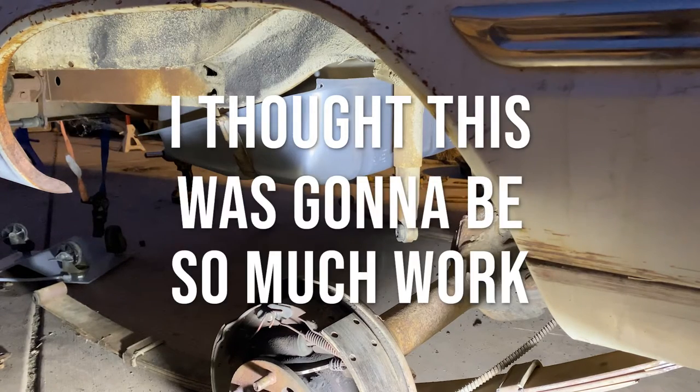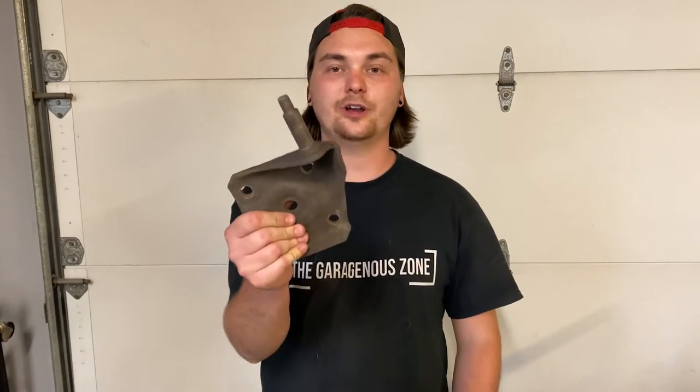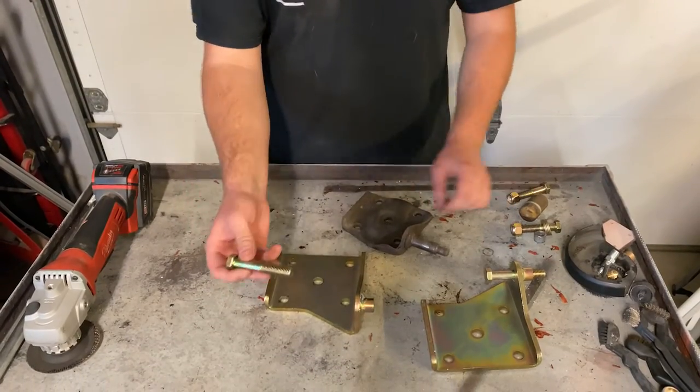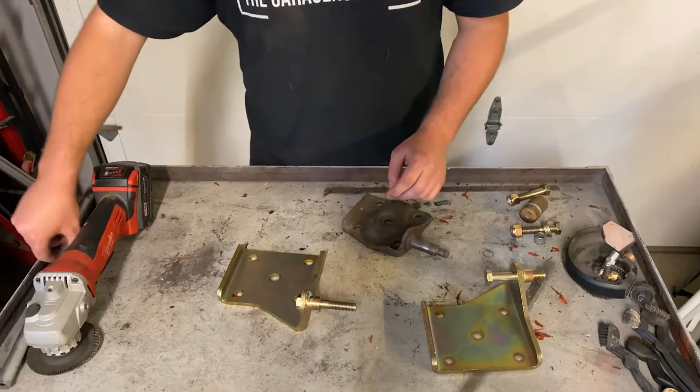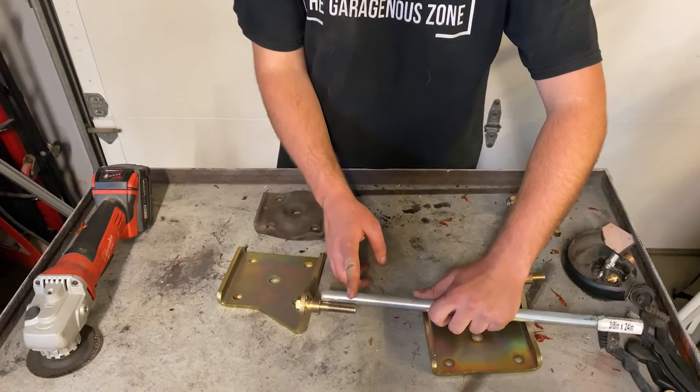That's insane — I thought this was going to be so much work. So we have a dilemma, but luckily it's one I know how to fix. This is the old spring plate from the Valiant, and when we swap to the 8 3/4 inch from the Roadrunner, this is no longer compatible. We had to order new ones for the 8 3/4, but the downside is they don't come with any shock mounting hardware — this is where the shock mounts on the old spring plate, but the new one doesn't have that. Luckily I've had to do this before on the 68 Dart we have. The solution is to take a bolt, run it through, and take a piece of tubing that you cut off to make a little sleeve that sits on top of the bolt. We'll cut it off right about there and weld it on.